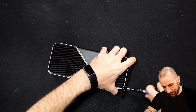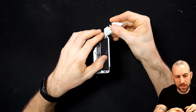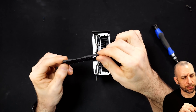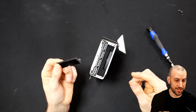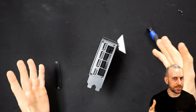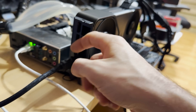So let's pull off the IO bracket first. This thing pops right out — it's actually purely cosmetic, and it actually feels plastic. I'm curious to see if just removing this thing makes a difference, because you could put the IO bracket back on and it still maintains your warranty. Removing it reduced the fan RPM by about 40 RPM, and I do feel increased airflow. But the air coming out is still cold, so we've got to dig deeper.